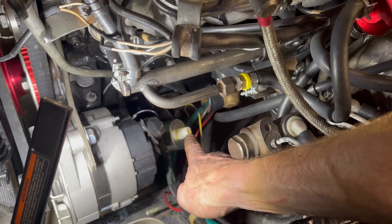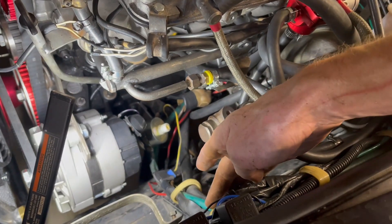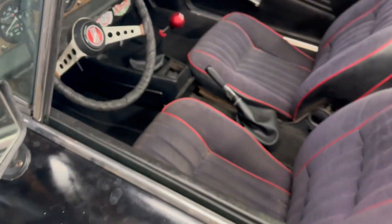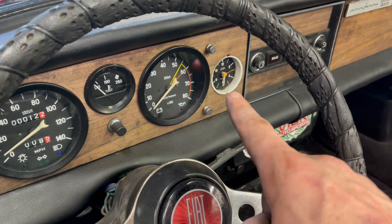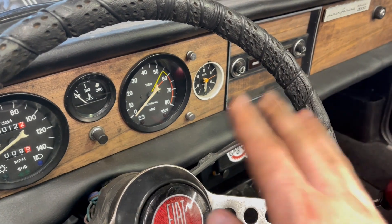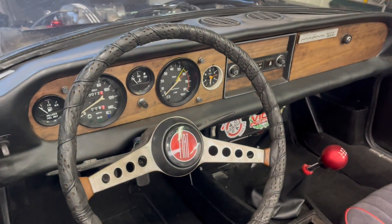We've already got the dummy light plugged in. Our next thing is plugging in a wire for the sender. Now we do not have one already installed on the car — it wasn't an add-on by the factory. So what we're going to do is run our own wire right up through the loom here, up across with the rest of these wires, back and through the firewall right there behind the engine. There's a grommet right here, and we're going to come through into the car right there where our clock is. We're going to steal the wire for the oil dummy light and skip it over to the gauge, and we're going to use some of the wires that are originally for the clock to power it — same ground, all that stuff is going to be really easy. Let's start getting these thumbscrews off, get the wheel off, and get this all out of the way.